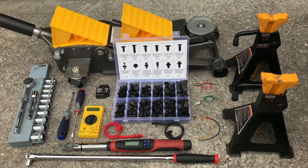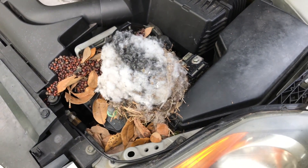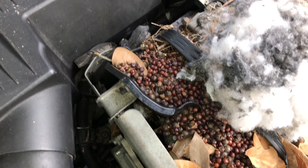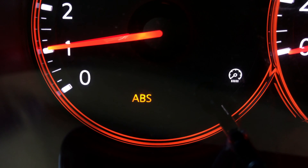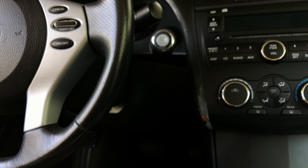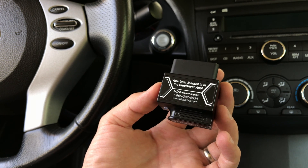Also, if you're interested in any of the tools I'm going to be using in this video, I'll list them all in the description below. Just a heads up — I think I already know what's going on here, because a few days ago I found that some animal decided to build its little house in here. To make this troubleshooting a lot easier, the very first thing we want to do is read the ABS error code stored in the ECU. To do that we're going to use a diagnostic scanner tool. Keep in mind that not all scanners are capable of reading ABS error codes — most basic entry-level scanners can't do that — so be sure to use a good scanner. I'm personally using this BlueDriver scanner; it works great and supports many different car brands.